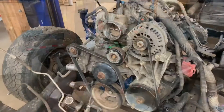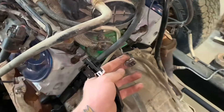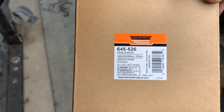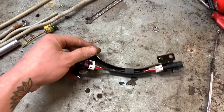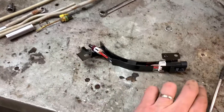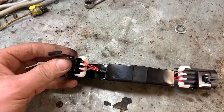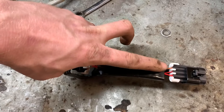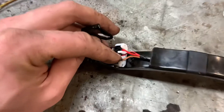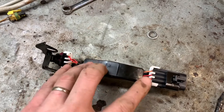Now the wiring and pin connectors between this front cam sensor and the rear cam sensor connector back here — the wiring is different, and that's where this little harness comes in. The part number is 645-526. I was all over Google trying to figure out how to pin the connector, because there are a couple of wires you have to switch between the Gen 3 connector and the Gen 4 connector — not knowing that this little harness does the switching for you. You can see that the brown wire starts over here and ends up in the opposite position down here. The red with the black stripe is in the center on both sides, so essentially they just switched the outside terminals.